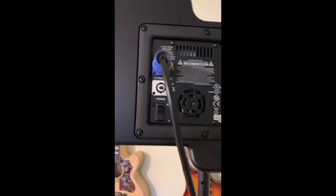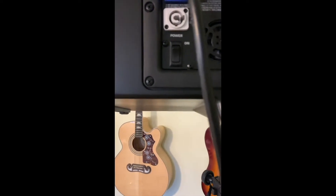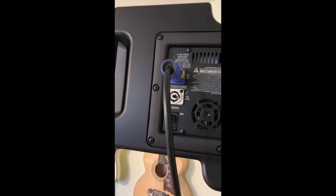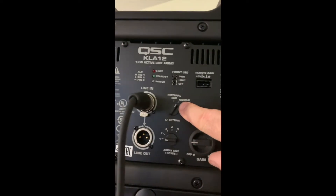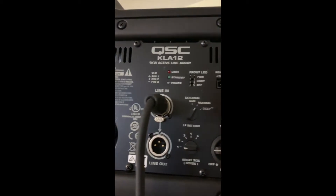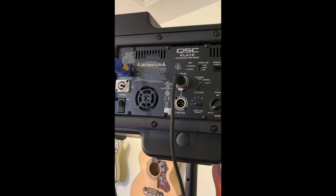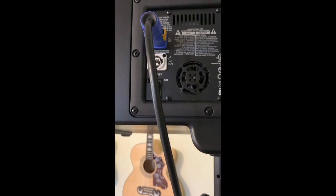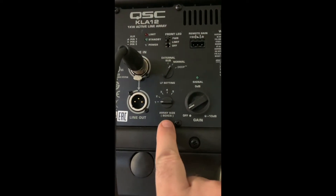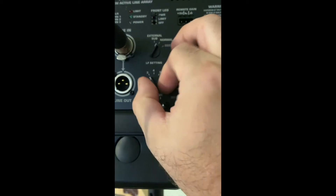Now, as we go to the back panel, you have your power input. This can run straight to the wall outlet. You can see how thick this speaker is. You can daisy chain more speakers off of that. This cord is coming from the subwoofer up to this. I have this set to normal full range — so this cabinet is not crossed over at all. We're using the crossovers from the sub into this cabinet. That's your level for your power amps. There are two 500-watt power amps within the cabinet itself — one is for the mid-range, one is for the highs. They sound incredible. You can stack up to five line arrays per side, so you would set it for one, two, three, four, or five.